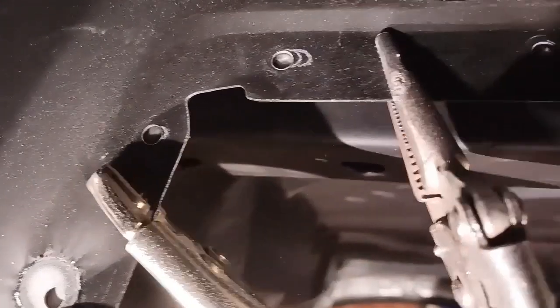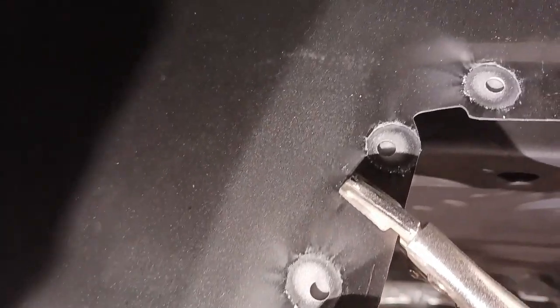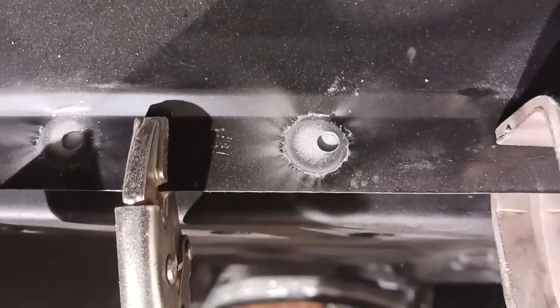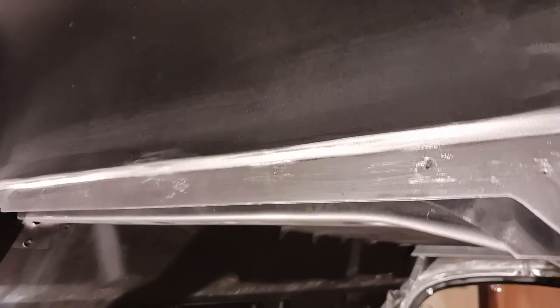And here I've already prepped the upper deck mating surface to the inner wheelhouse. And that's going to really aid. As soon as I strike that arc, it's going to allow for a better chance at a really nice plug weld. And one of the benefits of that is, well, you don't have to come back and grind anything. If you can do a one and done, hey man, that's ideal. And what we're trying to do with the plug welds anyway is mimic the factory resistance weld.